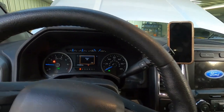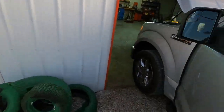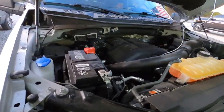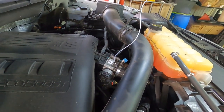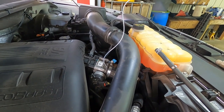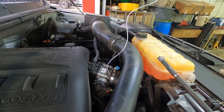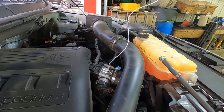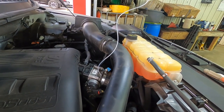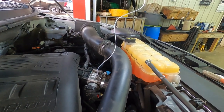The nine minutes is up. Next step is to shut the truck off, go out here, remove the hose from the throttle body, put the boot back on like it belongs. Then it says to take the truck for a 10 to 15 minute drive to make sure all the cleaner inside the engine is cleared out. While I was doing the process for the nine minutes, I didn't notice any smoke or anything coming from the exhaust. I think we'll take it out and get on it to see if anything comes out the exhaust — some black chunks or some kind of smoke. The stuff that got cleaned out had to go somewhere, and I'd think it would give us some smoke if it's getting burnt and going out the exhaust pipe.